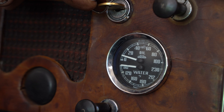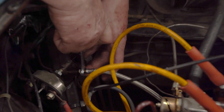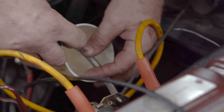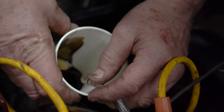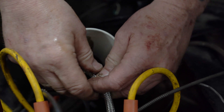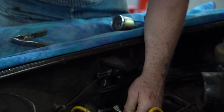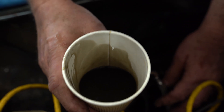We're going to test it quickly and check it for aeration. So here we are underneath the bonnet. It's a lot easier to use a glass jar when looking for aeration, but here's our hose — it comes off the engine. We're going to take it loose and just let it vent into here as soon as we start up the car. There's plenty of oil coming out, and there's no hint of aeration. When it's aerated, you can see the bubbles climbing to the top — it's not an uncommon problem.